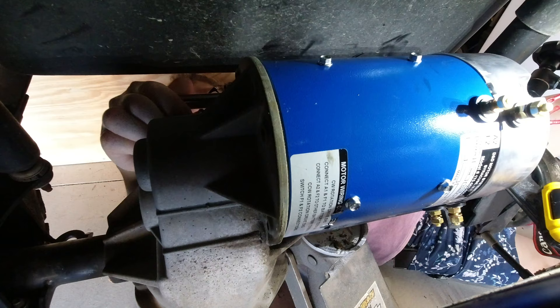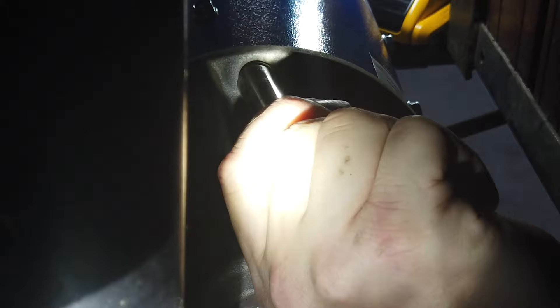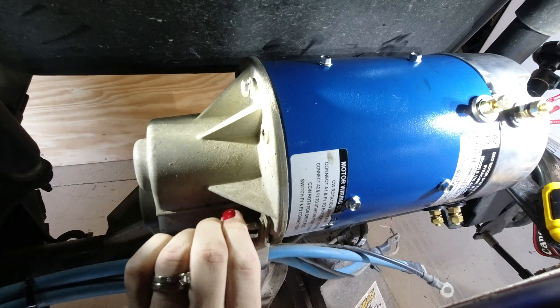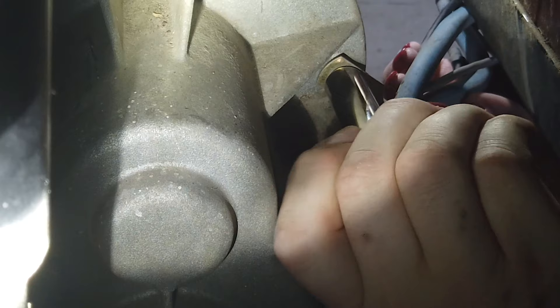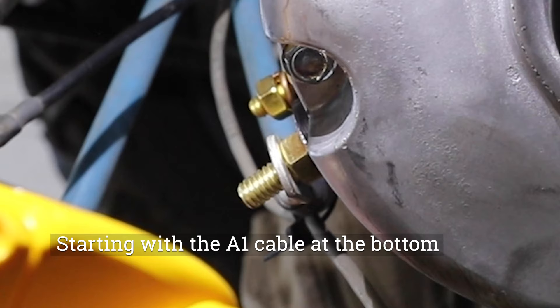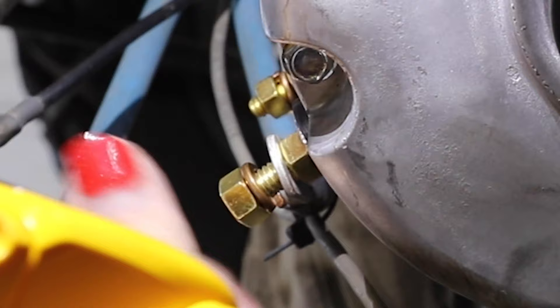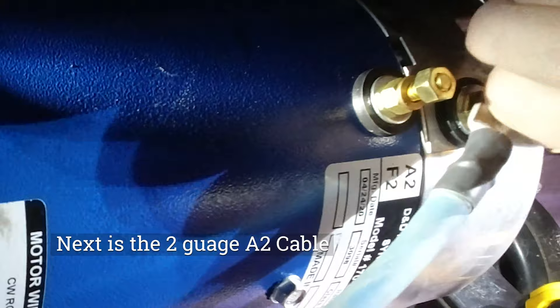Now I'm taking those 7/16 inch bolts and putting the three back in, hand-tightening each one. I'll do the rear one first, then the top one second, then the forward one third — just getting them snug, not fully tight yet. If you tighten one bolt down fully, you could misalign the motor and the second one may not line up correctly. It's like putting a wheel back on — snug the nuts up first before completely tightening. The new motor comes with new nuts and lock washers and they're pretty easy to put back together.